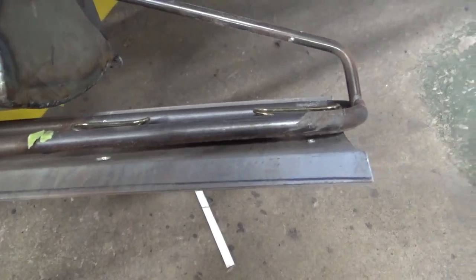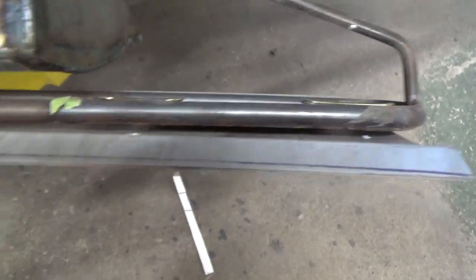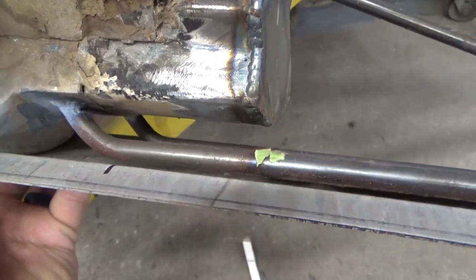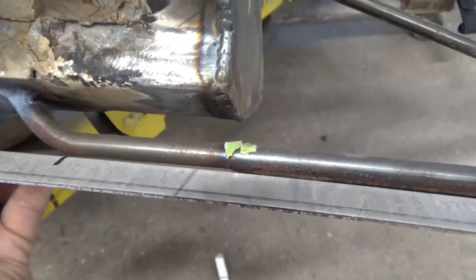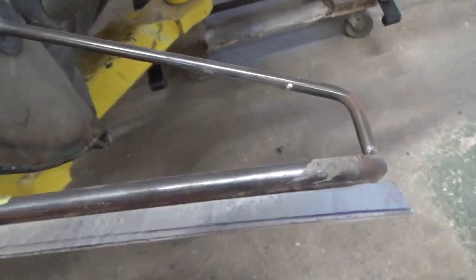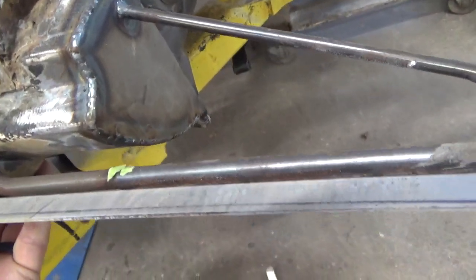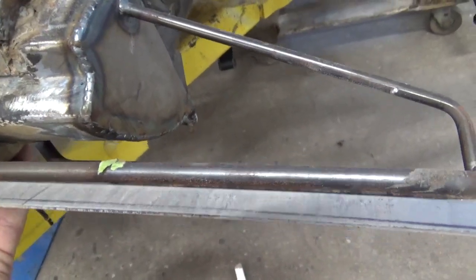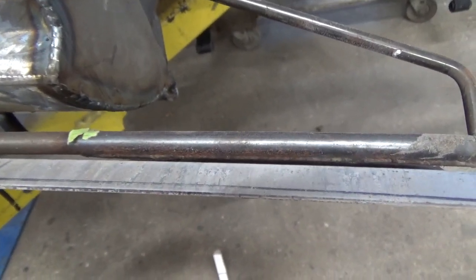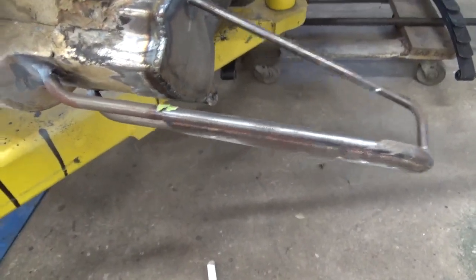And I tape that to the pieces of tubing that I've pre-bent. These are cut long, I'll fit them, and that way I can get in there to tack them real well. And then I put this little 1/4" tubing brace in there. As you can see, I've capped the end of the rocker. You know, I just MIG weld that stuff. And then that in turn locates the bottom of the fender for me. Makes that job a lot simpler.